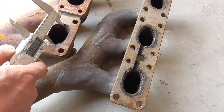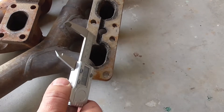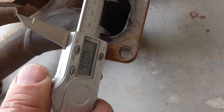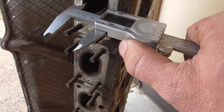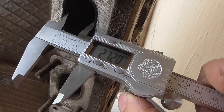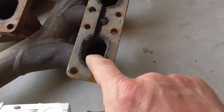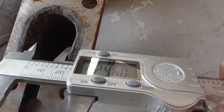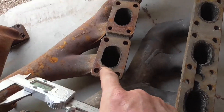Let's measure this direction: 40.3. Actually, it's slightly smaller in this direction. Let's measure the cylinder head port in this direction — 27. And the tubular one is again 24.5, so this is actually smaller. It has a smaller diameter. Let's measure the other one just so you can see it's the same.